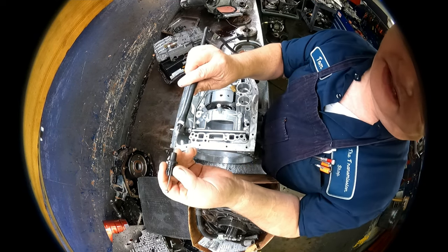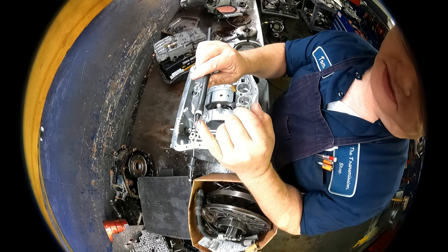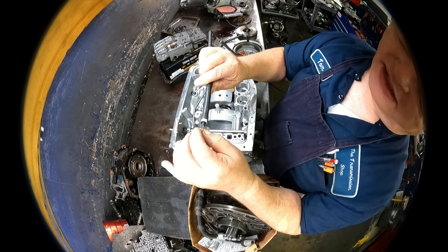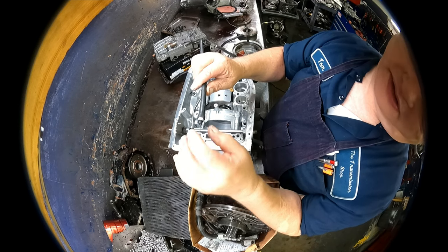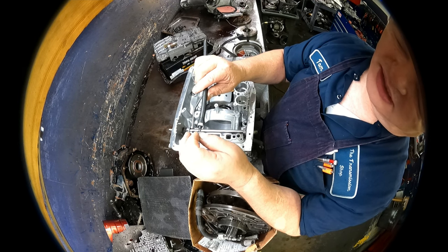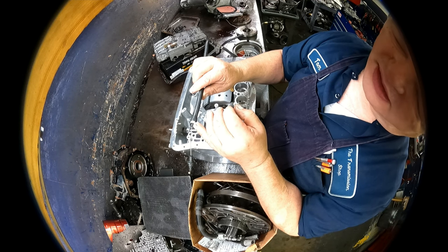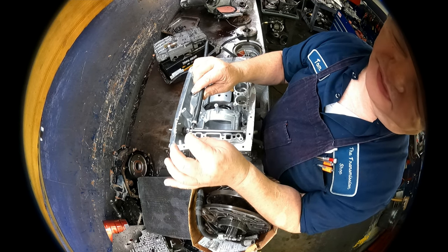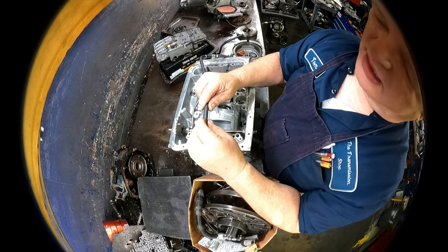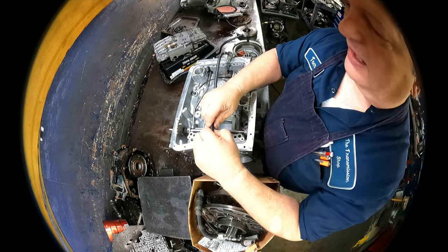Okay, Tech Pack Fits All makes a kit that will repair this. The tricky part's going to be getting this shaved down flush. We don't need these sticking out. So, however you can do it. If you got end cutters that you can clip that down, you can do it that way. You can use a cutoff wheel in your die grinder, as long as you don't nick this cable. And then to get the kit on there, we also got to slide it.